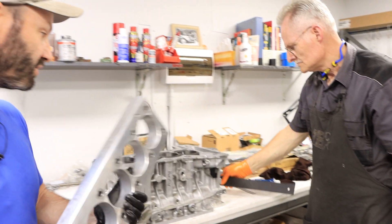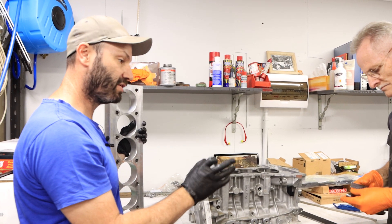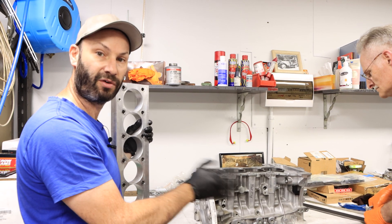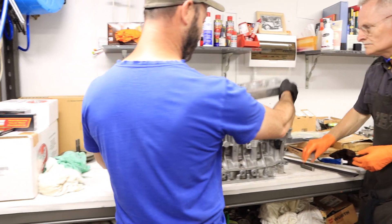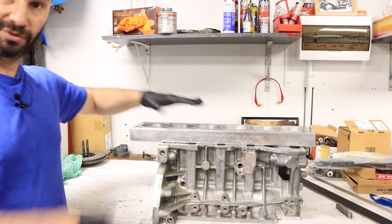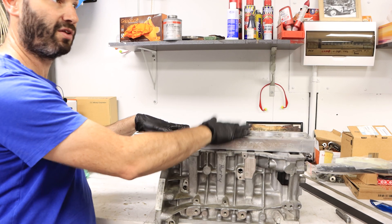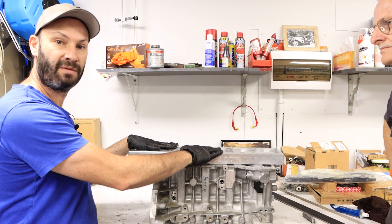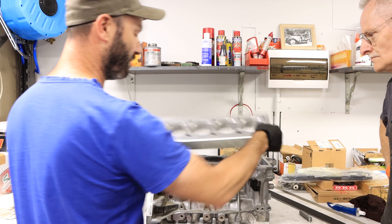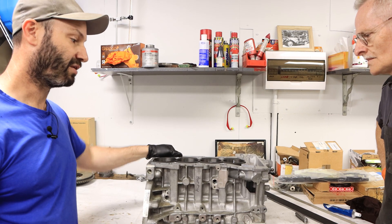So what we'll do next is we'll send this block away to get some machine work done — that'll include decking the block, and then we'll give a piston to our machinist and we'll get that bored and honed for the correct clearance. In that process we'll use an N55 torque plate which we've slightly modified to fit the N20. This will just sit over the liners like this, and the idea is that once we torque this down it'll really pull those liners down evenly for their final fitment. Then these can be bored and honed — that way it'll help lock the liners up in case there is any float there, though there shouldn't be with our interference fit. This will ensure that we've locked them down so we can do our machine work nice and cleanly. Then this will come off and we'll just skim the deck so that we have a nice flat surface, and then we're ready for assembly — we'll do our final wash and clean and assemble.